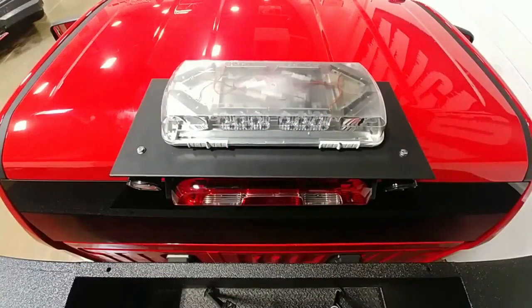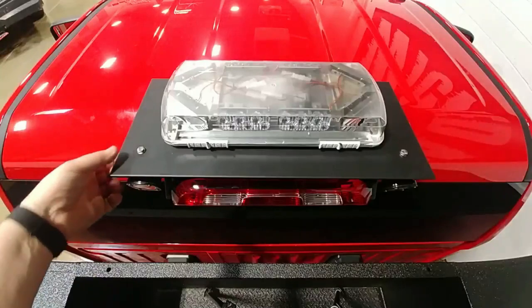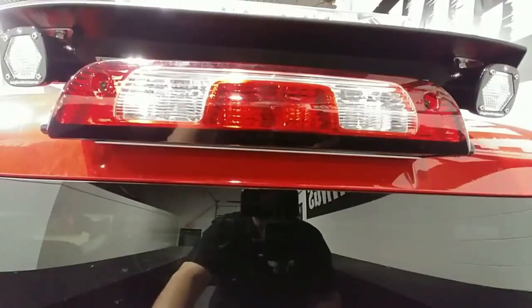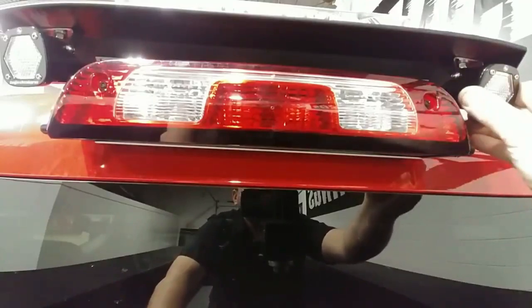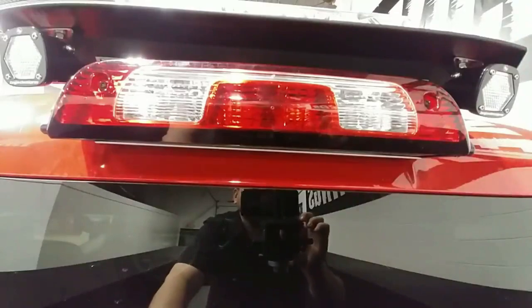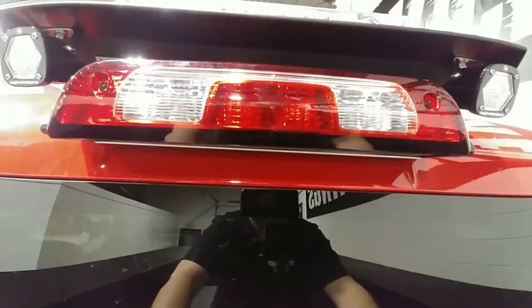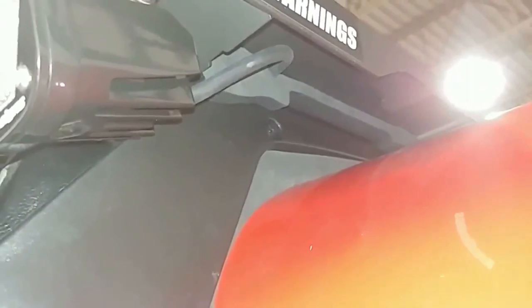To show you a closer look at these Baja lights: we used the factory included bolt and came down through the outer area of the Akari mount, the bolt on the bottom. We spun the Baja Designs faceplate around so it was facing the right way — if you turn them upside down, the Baja name will be upside down, so spin that faceplate so it looks correct. Watch your torque and do it evenly. You get a little bit of up-and-down adjustment via the screws. We ran the wiring right up and underneath the foam in the Akari mount — the wire comes out of the back of the light and runs up underneath that padded foam that seals up really nicely.